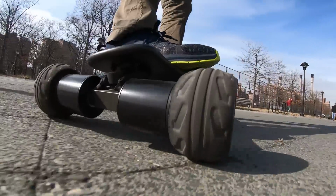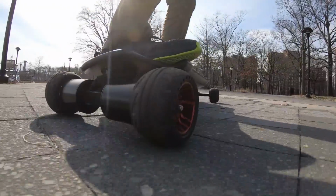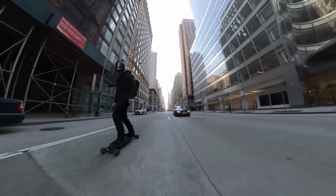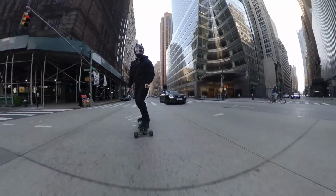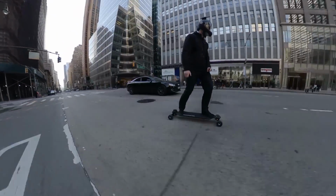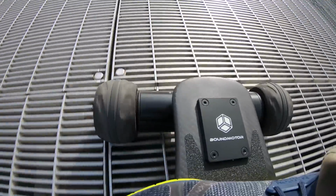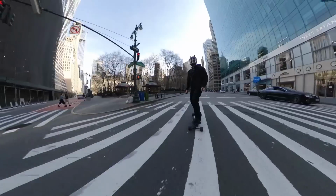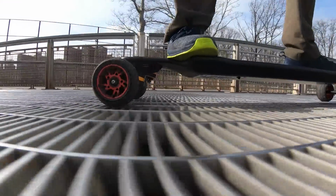Braking, it is amazingly good at any settings. Speed at 60 amps per motor, I was around 30 miles per hour with really fast acceleration. At 27 amps, I maxed out between 25 and 27 miles per hour, but it will get there a bit slower. You have to take into consideration, I weigh 230 pounds, so if you're lighter, you'll get much better performance.